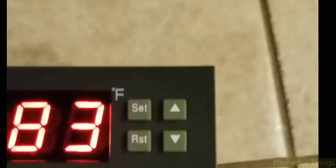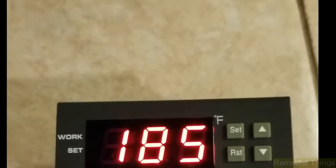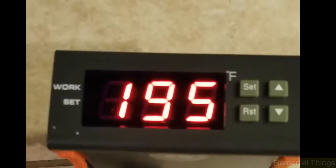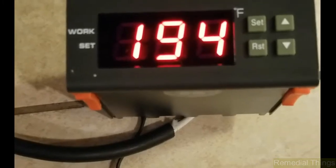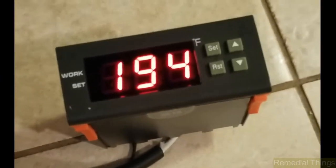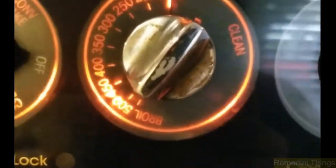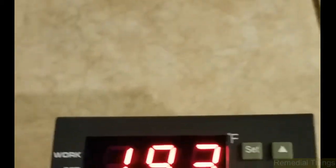I don't want to see anywhere near 220 degrees — I'm not trying to melt any solder. I'm just trying to make the metal case of the Xbox 360 hot so that I can set the board on it and have it preheat the board while I'm putting heat to the top to reflow the GPU. I'm getting pretty high now — I'd have to be careful handling it at 200 degrees. We can safely say the case will be about 195 degrees when I pull it out. That's about 100 degrees lower than our lowest dial setting — good to know.